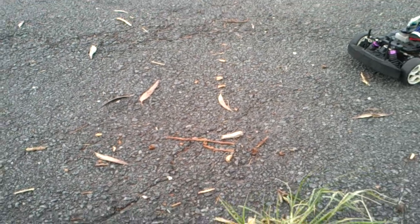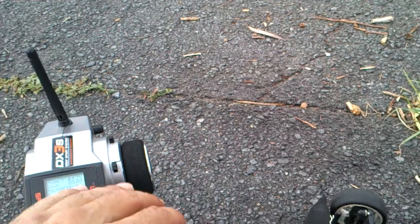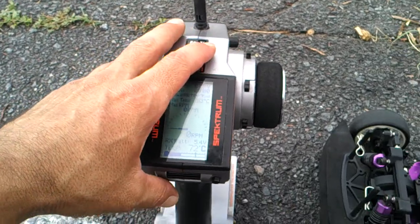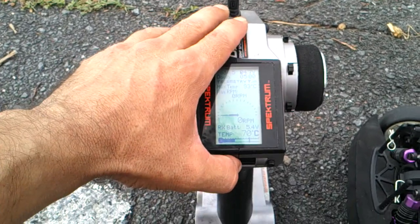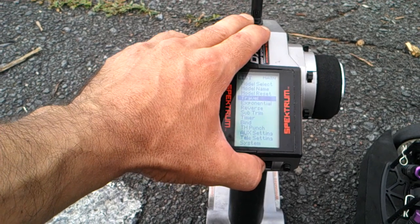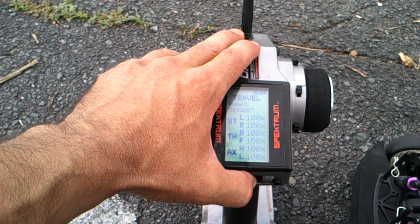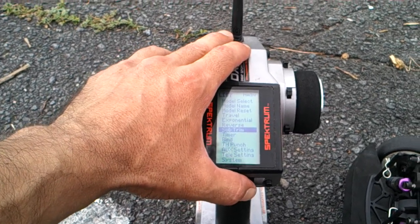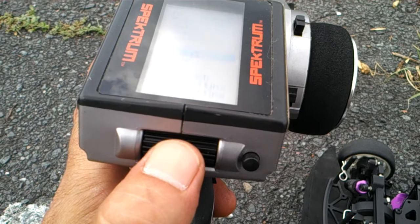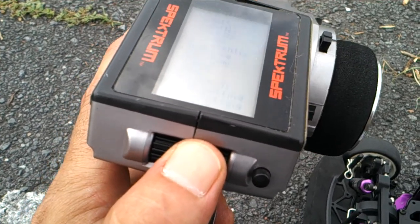We've just picked up a lot of pace there, and you keep on doing that until you reach stage three — that is pretty full on, very full on, high revs. If you don't want to blow your engine, come back to your transmitter, go into your settings and look for your throttle travel forward and backwards. Readjust it so you don't go full throttle on your carburetor. If you go full throttle and you're revving your engine beyond maximum limits, you will blow up your engine.